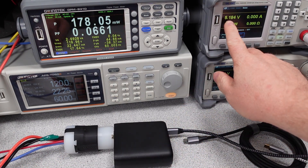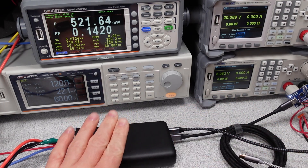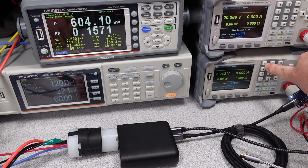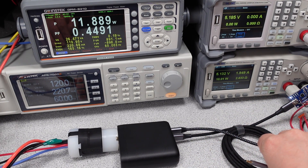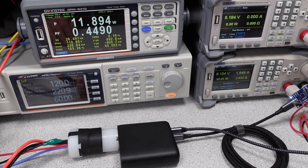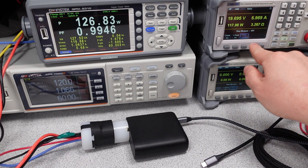The 65-watt is still the leader of the 65-watt adapters. The 5- and 9-watt power adapters are 5-volt-only devices. The 30-, 68-, and 100-watt devices add USB power delivery modes — they supply 5-, 9-, 15-, and 20-volt fixed voltages, and the 65-watt device is the only one that does the 12-volt mode. These power adapters all lack a programmable power supply or PPS mode to adjust output voltage, so they will not provide the fastest possible charge to some devices like Samsung phones. iPhones use the normal PD modes. At full power operating mode, the DC voltage is stable and they delivered the claimed rated power no problem. The overload trip points are available online; the link will be down in the description.